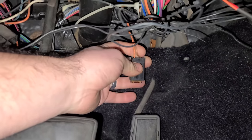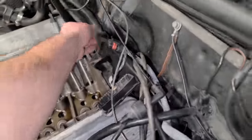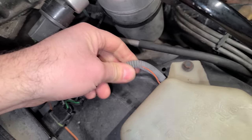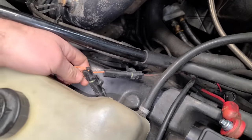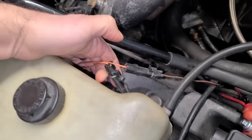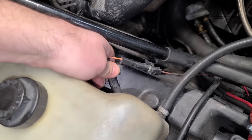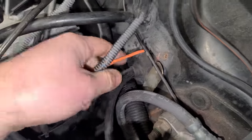I found a mystery fuse holder with exposed power wires — we cannot have that. It looks like this harness goes to the engine computer. You disconnect it to clear out codes. What they did was add a five-amp fuse so they could disconnect it from inside the car and reset the engine computer without popping the hood — essentially a check engine light clearing switch inside the car. We're not doing that — this has got to go. This is also where they ran the boost line to a gauge they used to have.